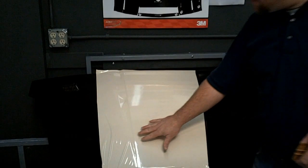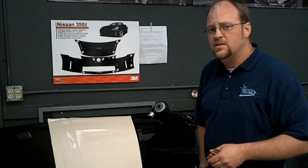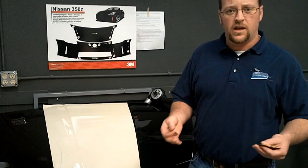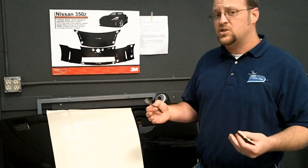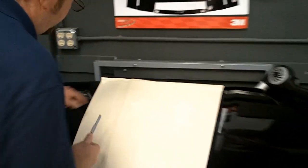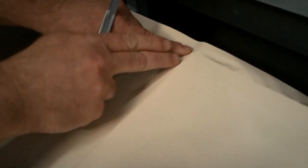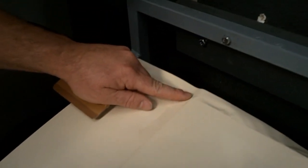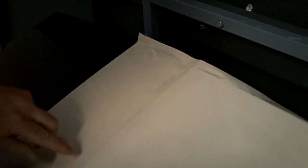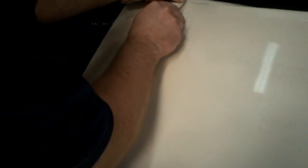Now, while the fineline tape does provide a good barrier, it's not completely cut proof. You're probably still going to want to cut in the same manner you would trim paint protection film with. Let's just score our vinyl and not try to cut through it. For good practice, you could also take another layer of tape to put on top to give yourself a more precise guide on where you're cutting. Otherwise, you could generally see where the line is from the tape underneath.